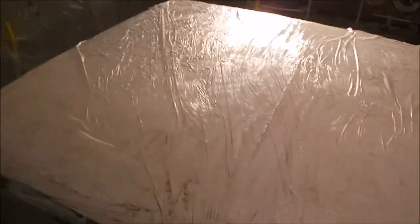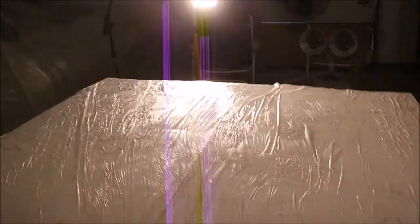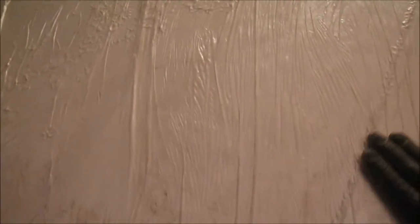All right, trying something out with this stripping action. I'm getting down to my last half a gallon of aircraft stripper, and I don't have too much left to strip. The biggest thing is this hood, so I'm going to try this trick that I've seen a couple of people do. You just put that automotive plastic on top of a bunch of your stripper, and you just keep moving that stuff around. It keeps it from drying out so fast.